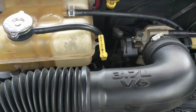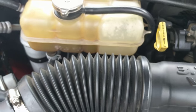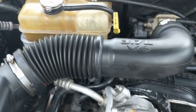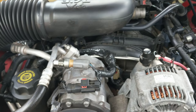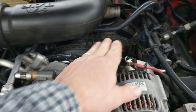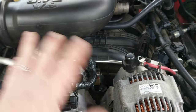Got to remove the engine oil dipstick from down below there so that you can lift this thing out. Probably have to remove the coolant reservoir — actually have to drain down the coolant just a bit because there's some coolant in the head that we don't want to come in contact with. Got to remove various connectors, got to come off of the alternator, perhaps the air conditioner here. Just kind of got to get all this stuff out of the way.